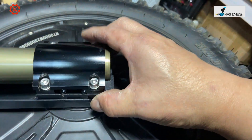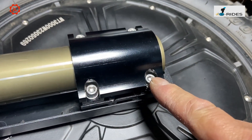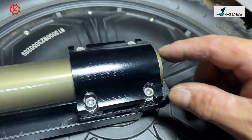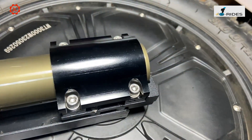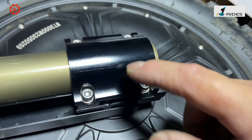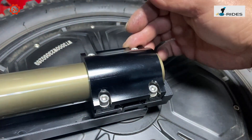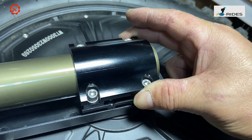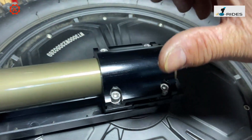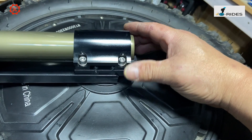So the bracket is back in and tightened up. I noticed you've got to be very careful with these screws — these are not high-tension screws and they clamp the suspension rod in place. You've got to be careful when you tighten this. Otherwise replace those screws with a high-tension torque screw, which will give you a bit more strength. But the bracket itself — I'm not sure how strong the steel or alloy is. Just tighten it enough but don't over-tighten, otherwise it will snap the thread. You turn it so you can't turn, but don't force-overturn it. This is the M4 screw holding the clamp for the suspension.